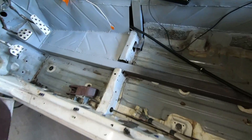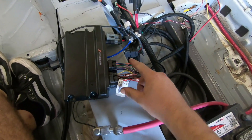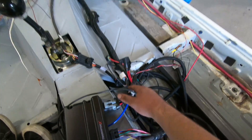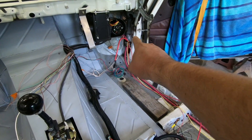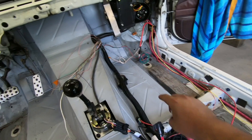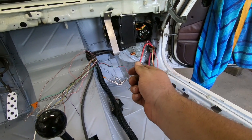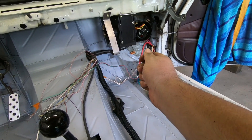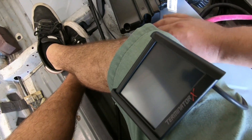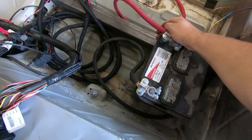Coming into the car we have a mock-up setup. The ECU is right here — these two plugs are for the main harness to the motor. This is your power harness, which goes over to a distribution block, and that distribution block comes right over to the battery. There you have your constant 12V and switched 12V. And if you can see that orange tape right down there, that's for the starter — just touch that on the distribution block to fire it up, then let go once it's running. The fuel pump is that purple wire.